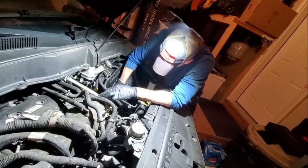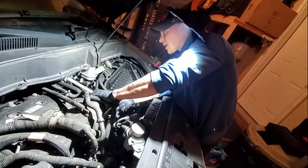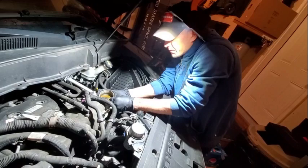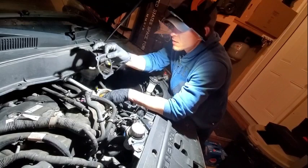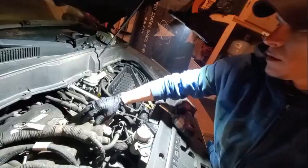There's a little clip for the air horn sitting in there. This thing's had chains done on it already — I made sure of that before we bought it. Now this is the older intake system, so you can see we've got a metal throttle body gasket. I'm not replacing that, although you should — if this were a customer's car I would definitely replace that.